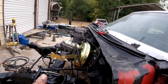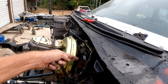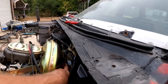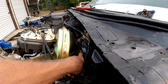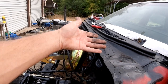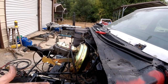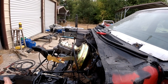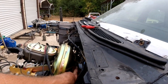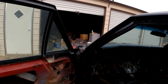I screwed up last time because I wasn't reading the directions. The brake pedal housing has two holes in it - this was manual brakes, didn't have a power brake booster, so it was connected to the top hole. That's what I did - I connected it to the hole it came out of. Put in the new bracket and everything, put it back together. Then I read the instructions later on and it said if it has two holes, to put it in the bottom hole, because the top hole is for manual brakes. I couldn't remember until I just watched the video I uploaded.